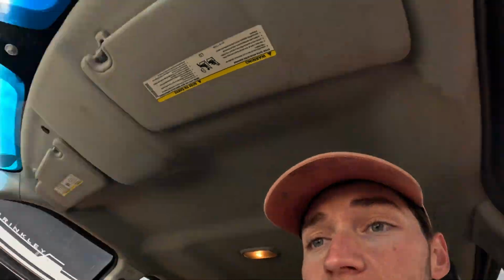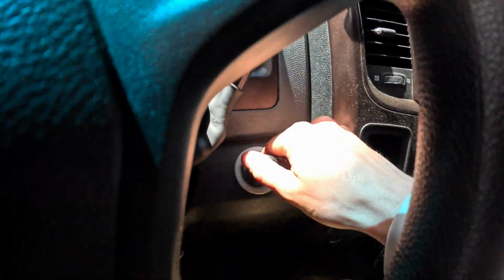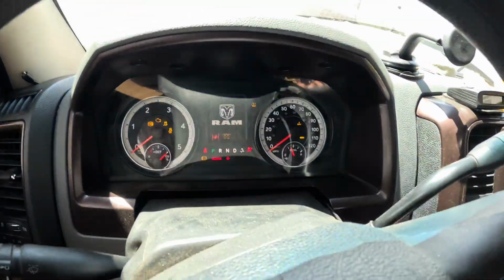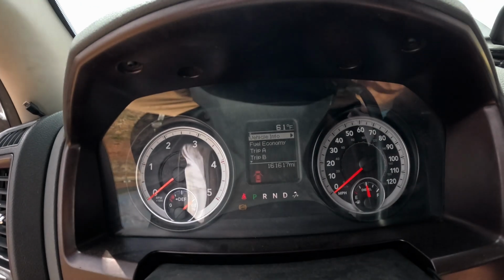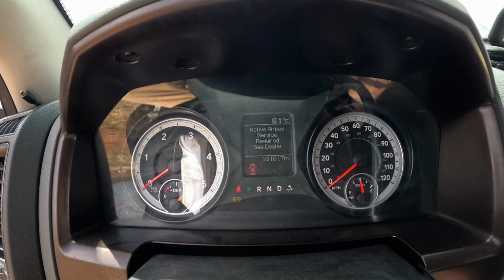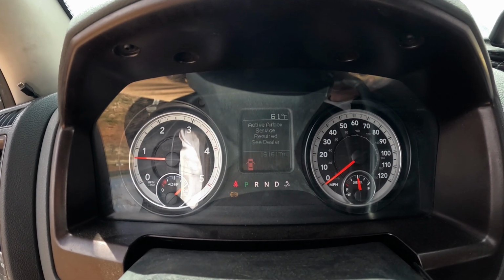So here's just an example. Put the key in, let it prime up, because you're trying to fill the water and fuel separator in the back, and you're filling your front fuel filter. Let's start her up. Check for some leaks.